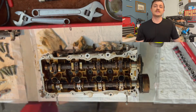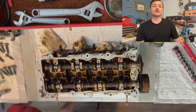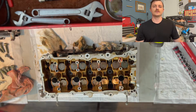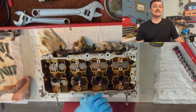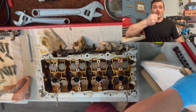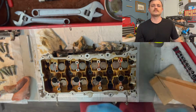The feeler measurements I just took are the thickness of the feeler gauge that would fit between the camshaft lobe and the cam follower. For those at home, you should do a quick Google of what a cam is. I'll give you the Oxford definition. A projection on a rotating part of machinery designed to make sliding contact with another part while rotating to impart reciprocal or variable motion.